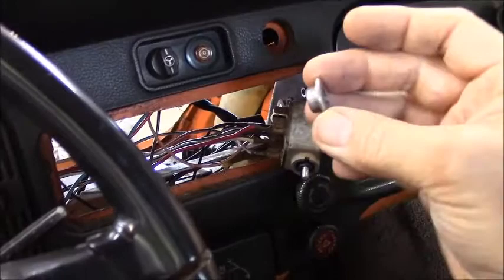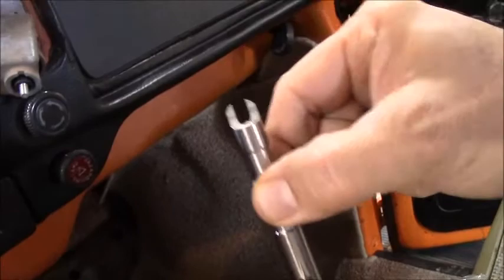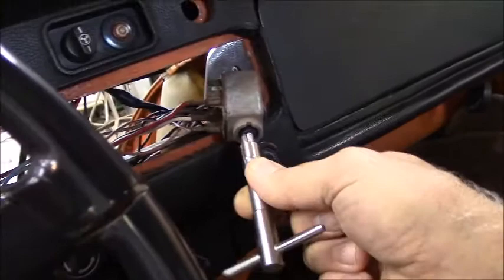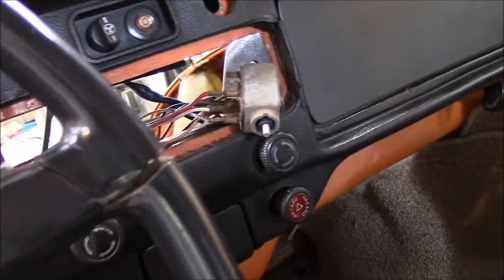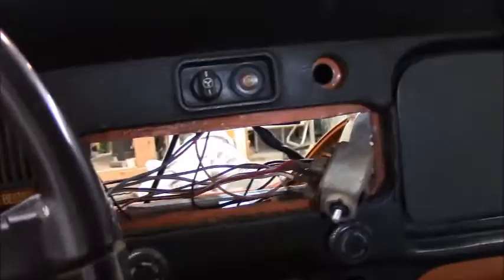There's a little top-hat kind of connector that goes on the front — how do you tighten or loosen that thing? J-Bugs has a tool, a little forked tool that reaches in over the shaft and allows you to loosen and tighten it, so I bought one. I got my new switch — it appears to be exactly the same except this terminal is what they call a 110, a little narrower one, and on the original it's a wide one. I'm also going to put heat shrink on every one of these bare open connectors because I hate everything laying wide open like that.